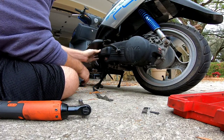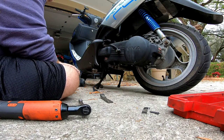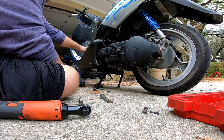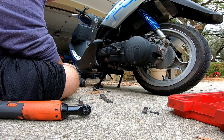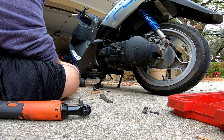I will say it needs a new belt — we'll talk to him about that. Unfortunately I don't have a belt in the exact size he needs right now, so if we were going to do that we'd have to order it. But I think just cleaning it will probably solve a lot of his speed problems — it looks like the rollers were getting a little stuck. Now let's work on the hard start issue.